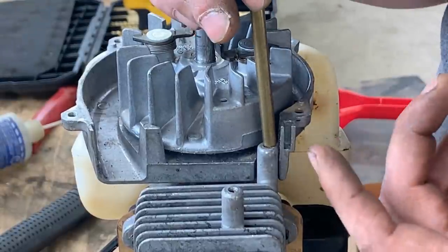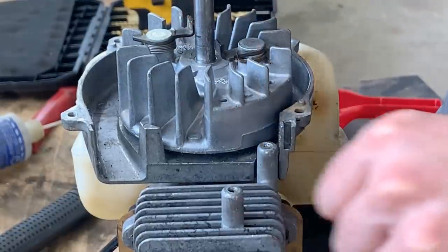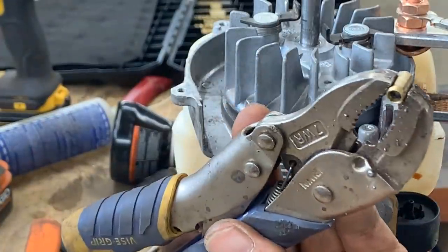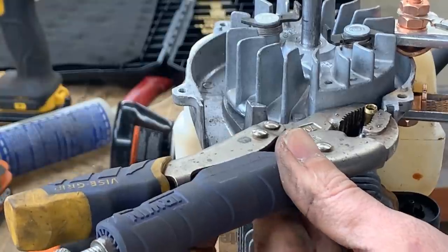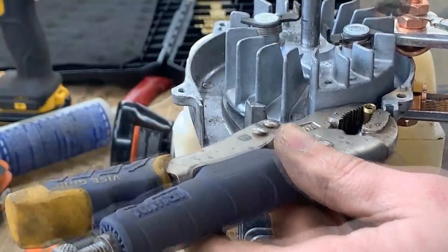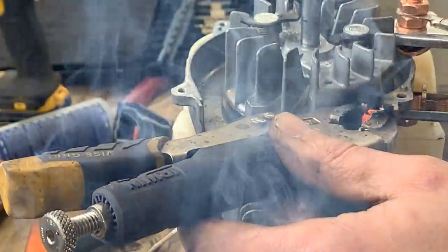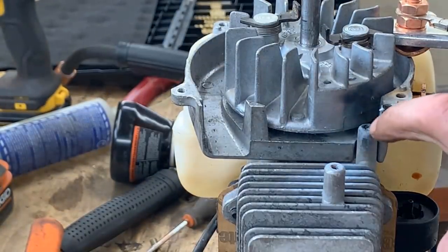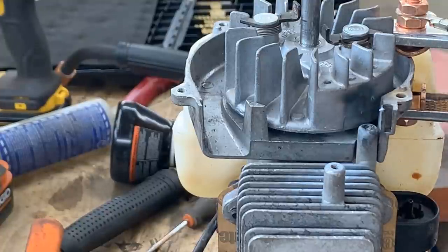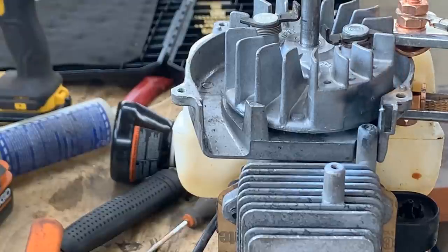And then first of all, that's gonna put heat on the screw. And second, that's gonna give us something to grab on and try to shake it loose. So I have the tube on a vice grip, and I'll try to locate it right on top of the little screw, and I'm gonna try to weld inside. Okay, you know what? We have aluminum outside, so we don't even need the brass. I'm gonna try without the brass.